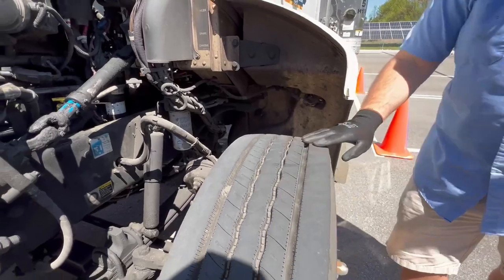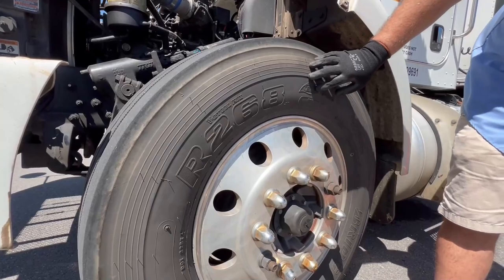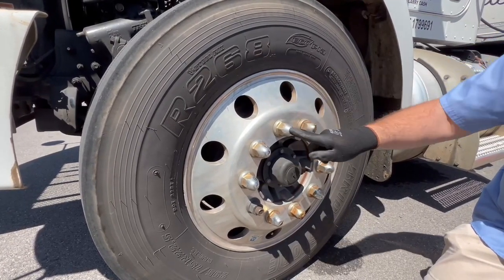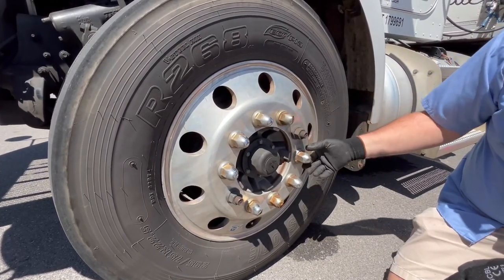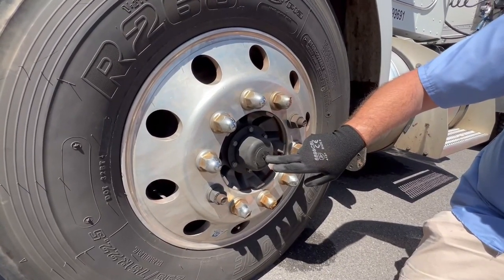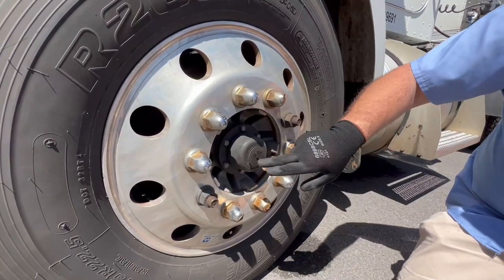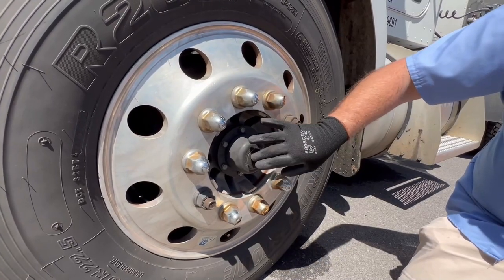Check the tire all the way around to make sure there are no flat spots. You need four thirty-seconds of tire tread, and these have to be virgin tires — they can't be retreads. Check the outside of the tire for abrasions, bulges, or cuts. Outside of your wheel — properly mounted, secured, not cracked, bent, or broken, no illegal welds. Your lug nuts must all be present, properly mounted, secured, and with no rust indicating looseness. Behind this hub is your hub assembly oil — properly mounted, secured, not cracked, bent, or broken, not missing nuts and bolts, at proper level, not leaking. On top of it is a hub assembly oil seal — check it for abrasions, bulges, cuts, and leaking.